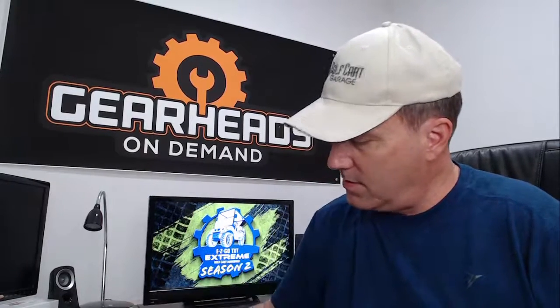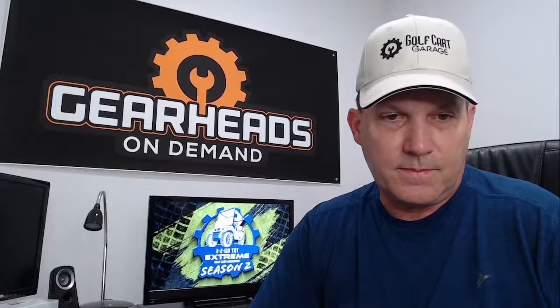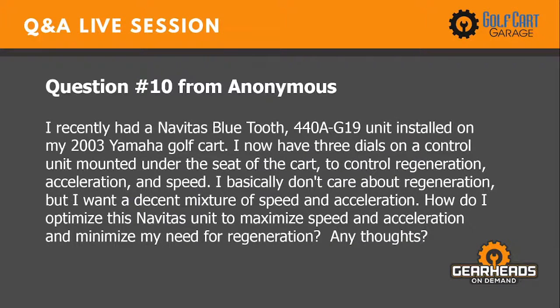Let's see here. Number 10. I recently had a Navitas Bluetooth 440 G19 unit installed on my 2003 Yamaha golf cart. I now have 3 dials on a control unit mounted under the seat of the cart to control regeneration, acceleration, and speed. I basically don't care about regeneration, but I want a decent mixture of speed and acceleration. How do I optimize this Navitas unit to maximize speed and acceleration and minimize my need for regeneration?